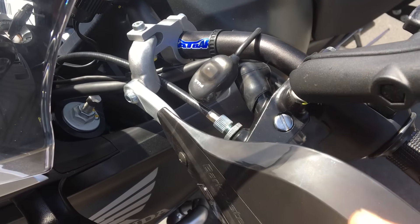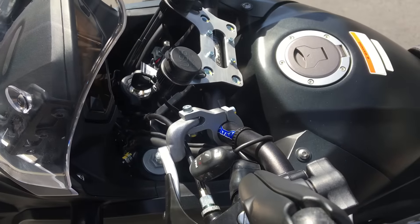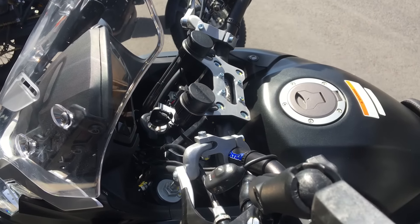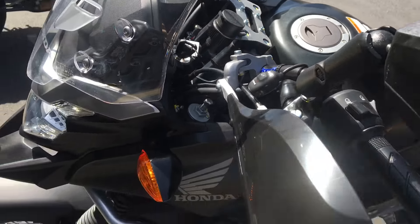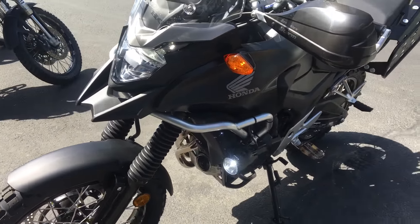So what's that? That's for the driving lights. So the driving lights — you put in one of those relays, right? Yeah, and when you turn the ignition off, these wires go to the ignition. You can hear that relay click. So you eliminate the risk of running your battery flat.